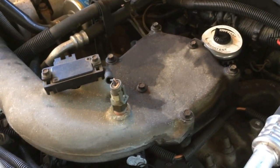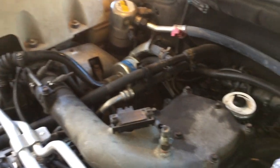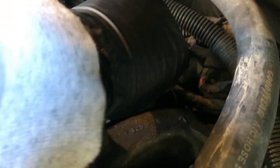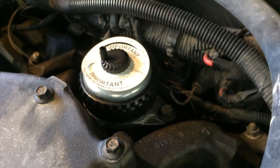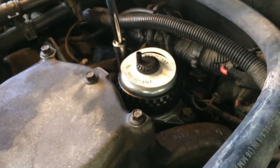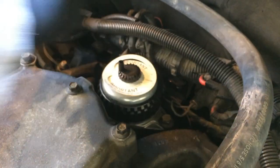You're going to have to trust me on the next one — swap out your 10 millimeter socket and go with a 15. What we're going to do with the 15 is loosen the fuel filter. We need to loosen this because it's going to give us some clearance to get at the oil pressure sender. I'm going to go kind of slow because I do not want these bolts falling down here and ruining my day.